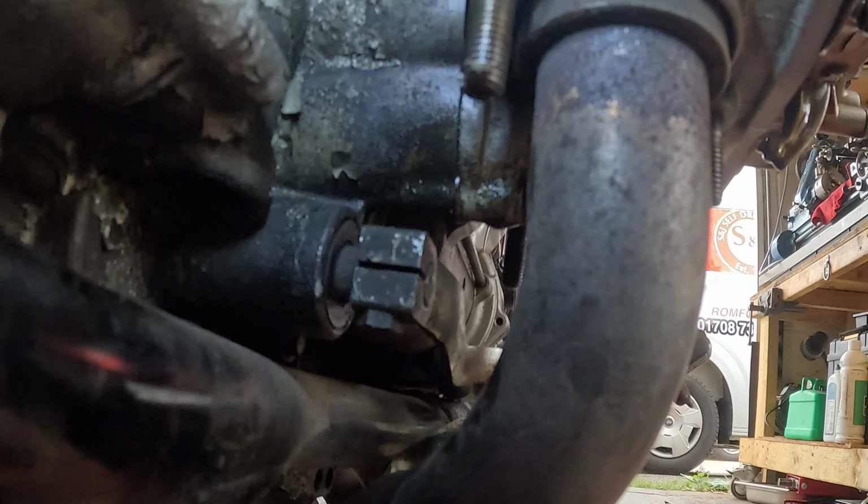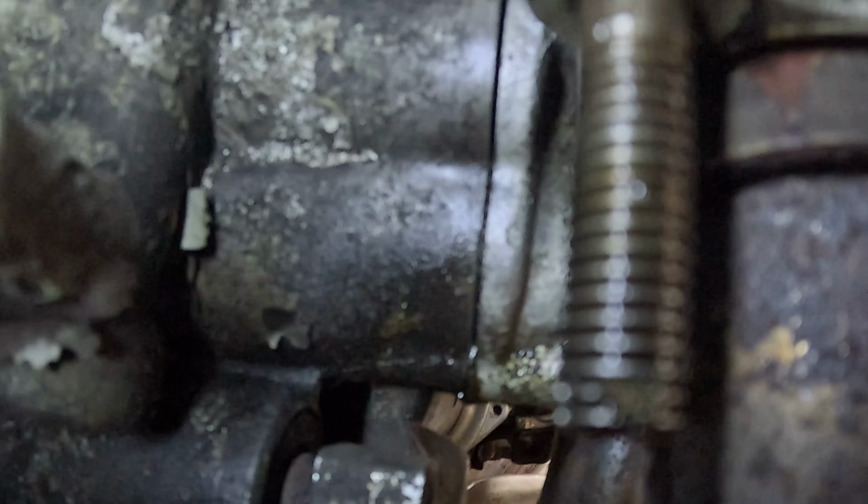Right. There we go. Let's get a torch in there now. Oh, look. There's definitely a gap there, but now I'm not sure if the gasket is actually missing. I think I can see it inside. Now I've got some of the engine off, you can see that. But what I do think is, if we come under this side, it's definitely splayed out there on the right. So I'm just not sure it's positioned right to give us the correct seal.